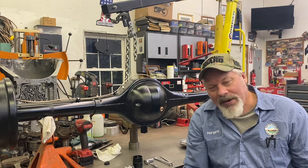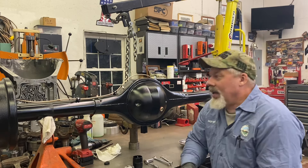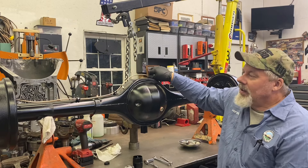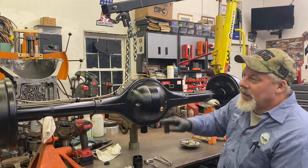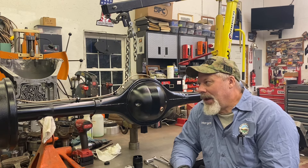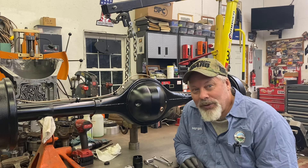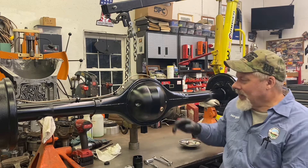So I'm going to make this line here. I go ahead and put the nut on, flare this end, install it here, and then rough it out. I just take a wild guess and cut it off — not scientific at all. I always start with the long one; that way, if I mess it up, it would probably fit over here. I have a tendency to make them too short, but this one actually came out pretty good — it's the right length. I'm all primed up now. Let's build this side.